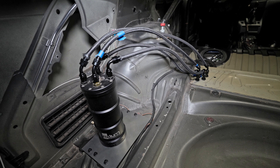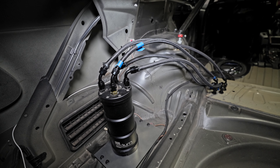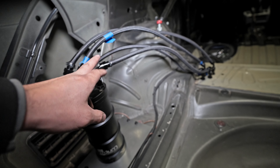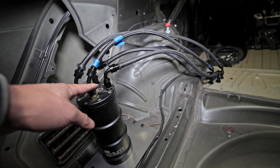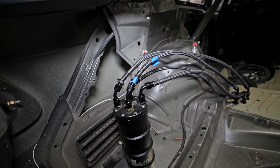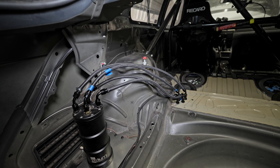Okay, almost done. I put all the lines together — I haven't finalized them yet, I didn't put the ferrule or the back of the fitting on just yet. I ended up putting the 45 degree fittings in the back and the 90s in front, mainly because if they were all 90s they can't quite cross over each other — they kind of just hit and interfere with each other. So I did the same arrangement for the back. I think this is what I'm going to go with.